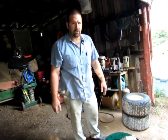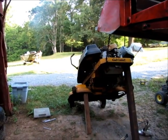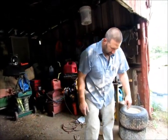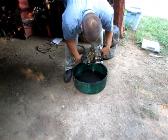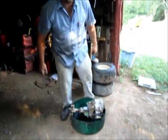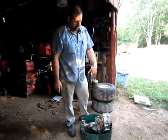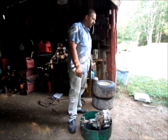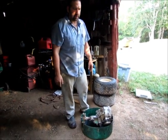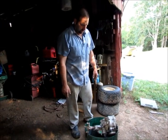I didn't get the mower super hot because you're working right by the exhaust and it gets so hot you can't hardly touch it. So what I might do while I've got it apart is go ahead and take the other side off and change that oil too. But this looks terrible — it's just a nasty gray mess. The instructions I downloaded online for this gear say you're supposed to fill it up until it's about an inch from the top of the drain plug hole. It said to use 20w50 motor oil, so I'm going to try that out.